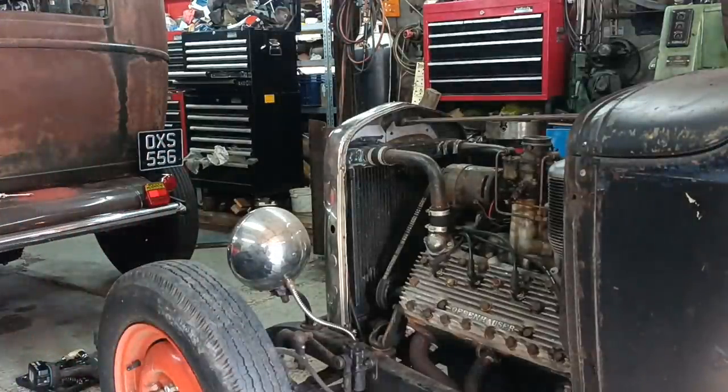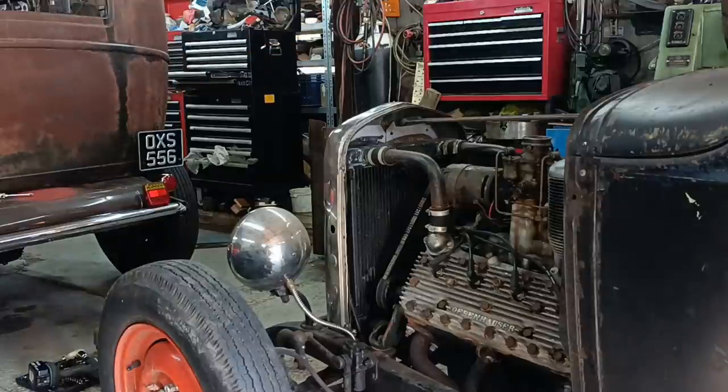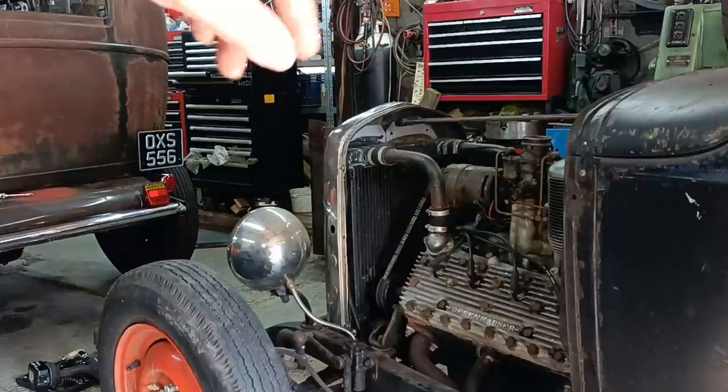Okay, it seems to be a little bit better. It did restart then after a couple of squirts. I think everything needs, you know, to get used to having fuel in it again. I think things have dried out, you know, like the accelerator pump and things like that. So